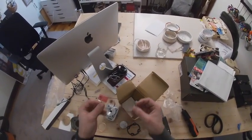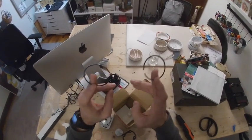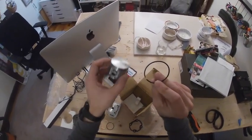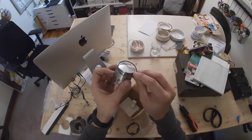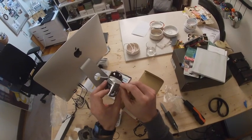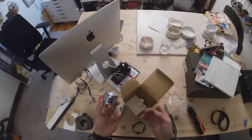These rings are identical — you're going to see some markings on them. It does not matter which one you put on first because they're identical, but the numbers must face up. Also notice there's a cutout in the ring — it is for a locating pin on the piston. These two pins mean you physically can't put the piston in unless the rings are located properly. Scraping the base gasket and installing these two circlips are the hardest things you've got to do. There is no timing with a two-stroke motor.